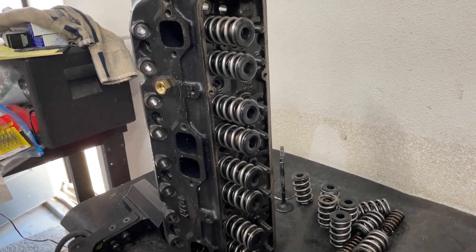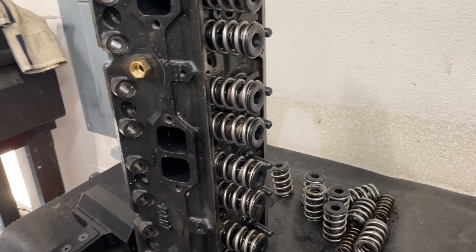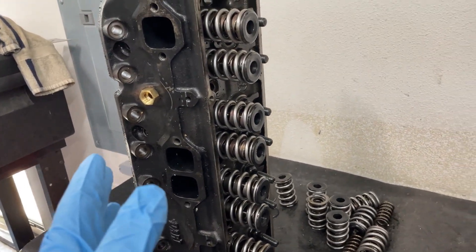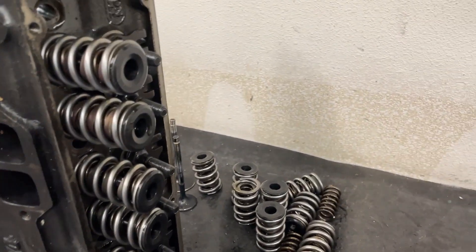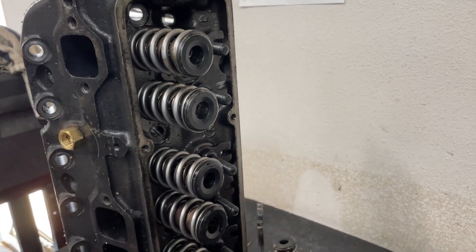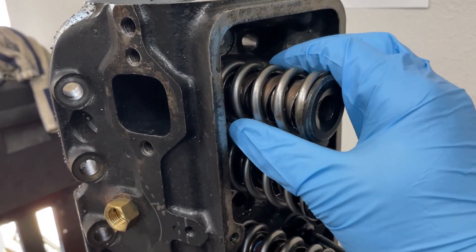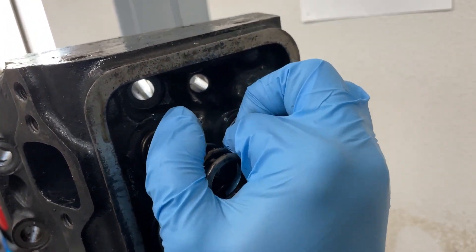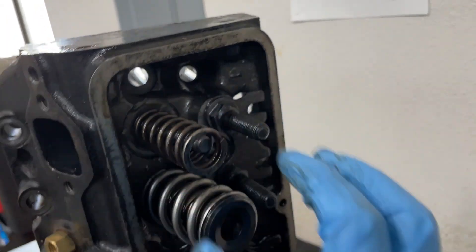Since you guys made it to the end of the video I'll give you a little nugget of knowledge — a lot of you may already know this but if not, now you do. I always see weird stuff come through the shop that needs to be fixed. This guy brought a head in for a refresh — valve job, mill, that sort of thing. I'm tearing it apart, got the springs off. Here's how they are on the head — I got the locks popped off and I'm showing you this because something is wrong. When you put a spring in and take out the retainers, you should be able to pull it off. You shouldn't have to pull with force to get it off. That's wrong.